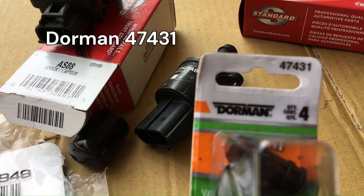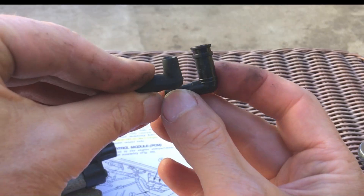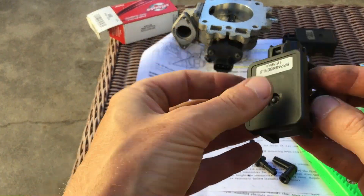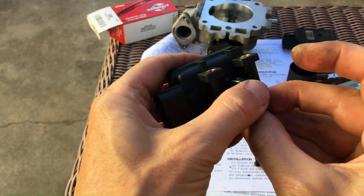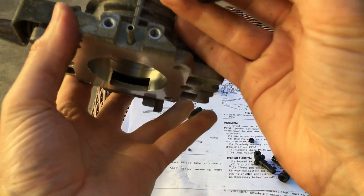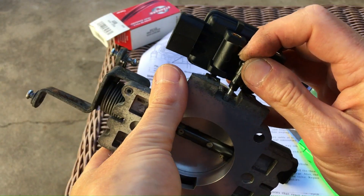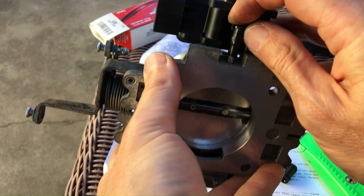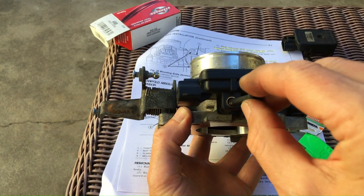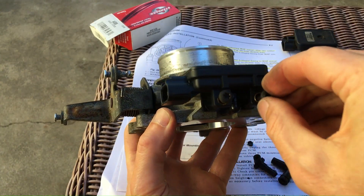That rubber right angle became a real pain, as I'll show you. Here's the replacement kit I was able to find. It has a variety of rubber attachments, but they don't actually match up exactly as you can see. So I had to cut it down with a knife and then test the length to fit into the nipple for the actual throttle body itself. If you do decide to remove your MAP, I would highly advise that you buy a specific L 90-degree rubber tube online ahead of time made exactly for your Jeep, instead of this generic kit.